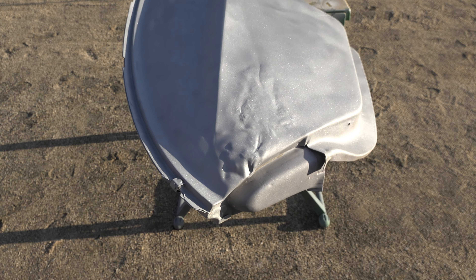To start, I begin by covering up all the black undercoating with paper and tape to prevent overspray from getting on it. And with that, the time has come — it's time to lay down some paint onto these fenders. I first begin this process by quickly sanding everything again to ensure the first coat of sealer adheres well. I then go over this freshly abraded surface with a final solvent wipe. While doing this, the solvent-soaked towel glides over the surface effortlessly, allowing you to feel everything on the surface. I feel a little bit of unevenness in my bodywork that I couldn't see previously, so I quickly knock this area down with some sandpaper before immortalizing this defect forever.